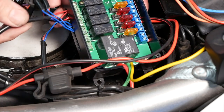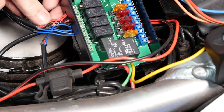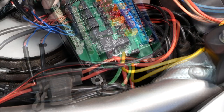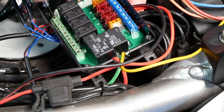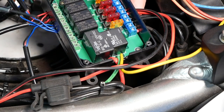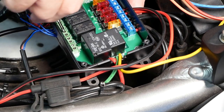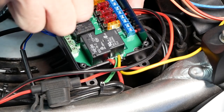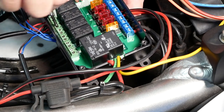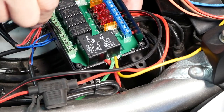The first thing I'm going to do is unhook the existing wires from my terminals to get them out of the way. I remember from my previous installation that my red wires are for my ShowChrome LED marker lights. I'm using a little jeweler's screwdriver to undo these because it's the only one that will fit down in there. The red wire is the turn signal — if it's coming from the left light it's the left turn signal, right light is the right turn signal. The blue wires are the running lights, and all of my blacks are grounds. It doesn't matter which terminal the black wires go into because ground is ground.